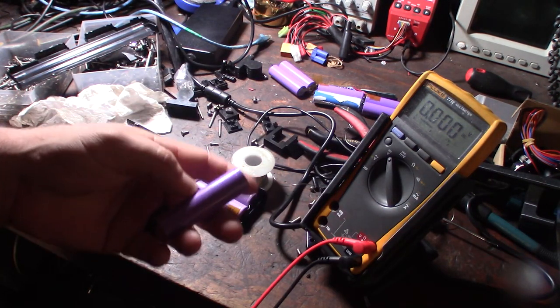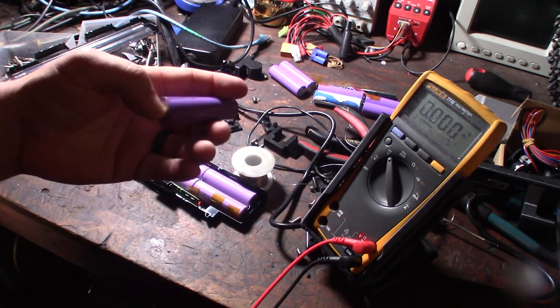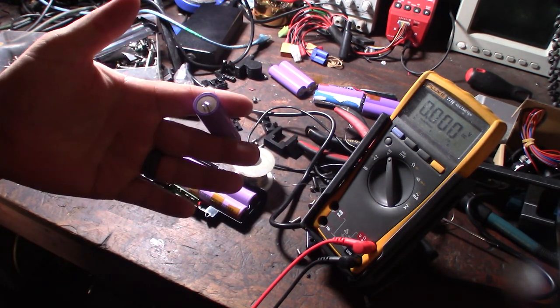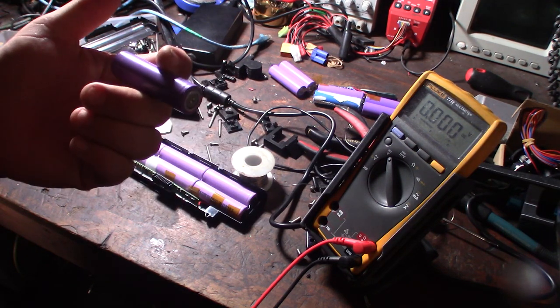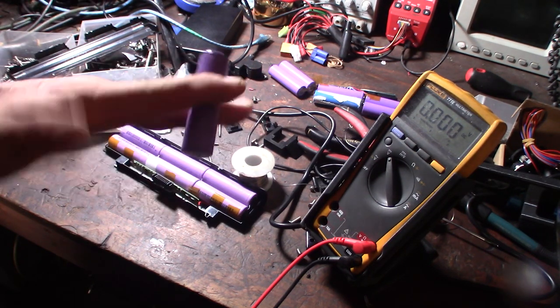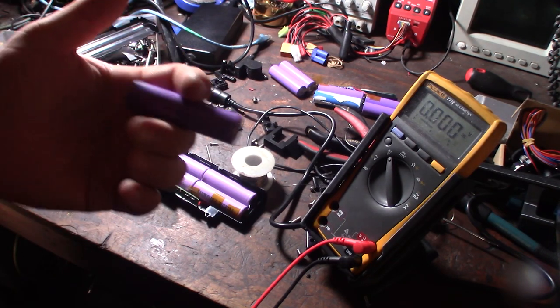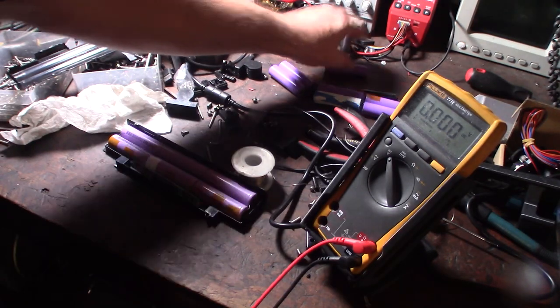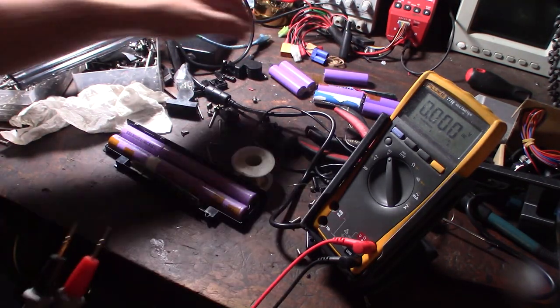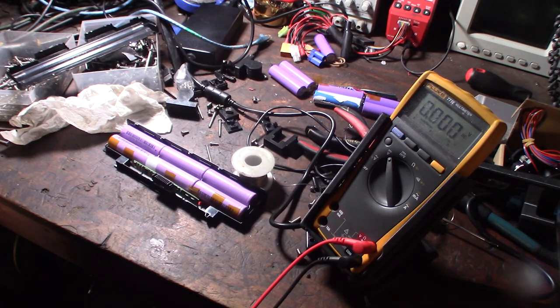But you can recover these reverse polarity ones. What you need to do is severely discharge the thing to the point where it doesn't show any sort of voltage. So you could hook it up to an incandescent light bulb or some kind of light bulb, right? That would discharge it so much that you could put it back in the right polarity again. But usually when it's been discharged that far, they're kind of damaged. So these things are probably severely diminished because they were so severely discharged.